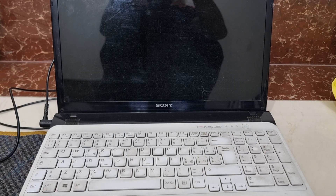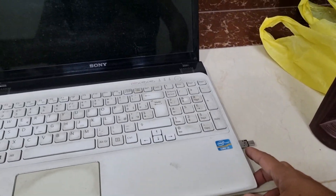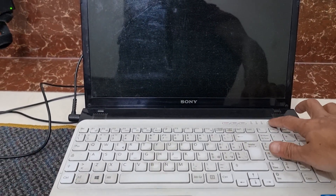Welcome to another computer-related video. This time my companion is a Sony VAIO, an old model laptop which comes with Windows 8. I recently changed the hard disk and moved to SSD, so this is the time to install a new operating system from fresh. Basically what we do is create a USB bootable pen drive, which I already did, and I connected it into the USB port. Then we should turn on the laptop.